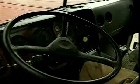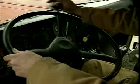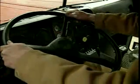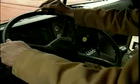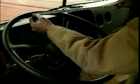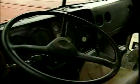Place a mark on the steering wheel, then while holding the marker at that point, turn the wheel in the other direction until the tires again start to move. Measure the distance between the 2 points. This is the amount of steering lash. Excessive lash can indicate worn or loose steering components.